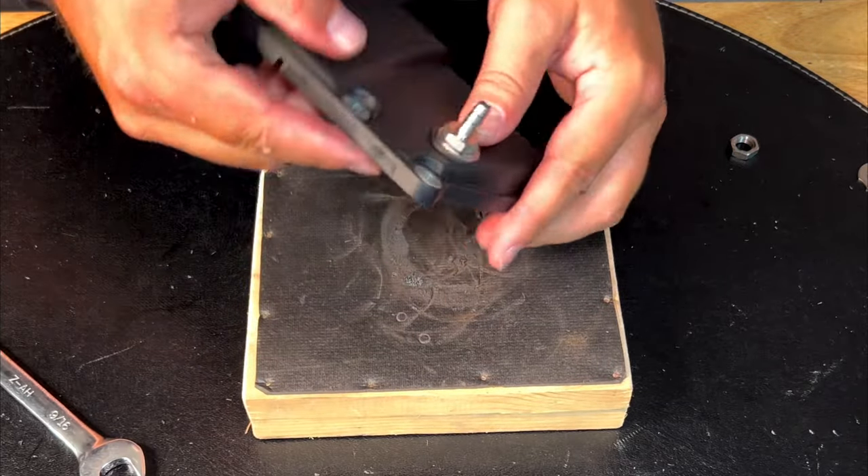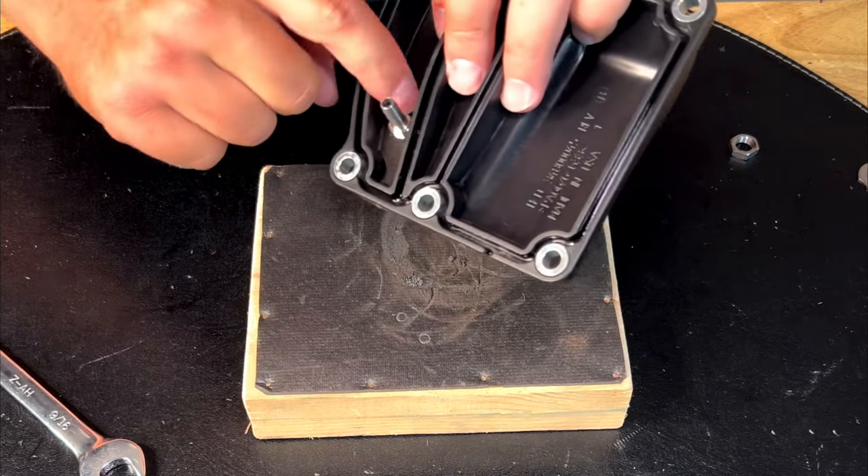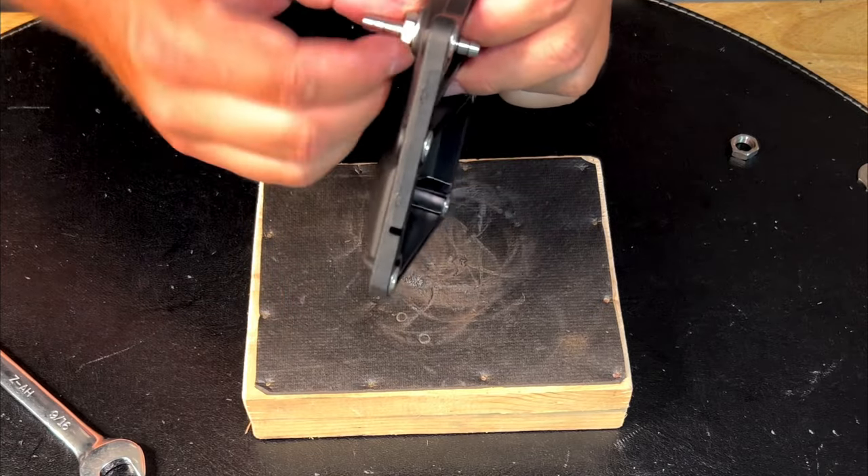As you can see, it created a really nice and tight fit — this is definitely going nowhere. I'm not adding any additional elements that might fall into the internal part, and we have this rubber gasket, so I'm not worried about leaks. However, I want to let you know it's probably a better idea to use red Loctite and some gasket maker to seal everything properly. After about 250 miles, I discovered there was just a tiny drop of oil — so the gasket alone is not sufficient. You can put the spigot the way it was designed, with the nut on the bottom side, tighten everything nicely, and use gasket maker to seal it properly — that's what I did later on and there were no further leaks.